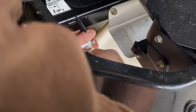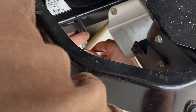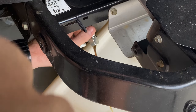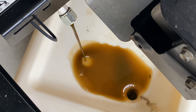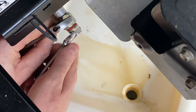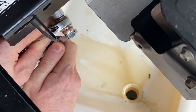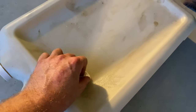Set the oil pan underneath the drain pipe. On the Cub Cadets there's basically a drain hose at the back of the mower. There's a square drive bolt installed and it does have thread locker on it, so it can be a little bit tricky to undo — I just use shifters but any correctly sized spanner will do it. Once it's drained, put the bolt back in. You may need to apply new thread tape or thread locking compound to the bolt when you put it back in. Mine still had plenty of gasket material on there so it held fine.